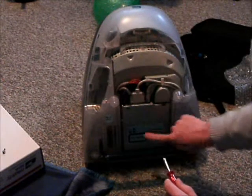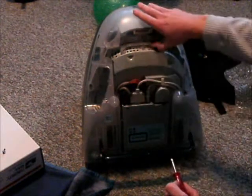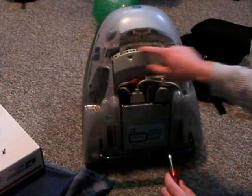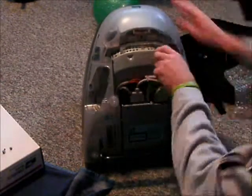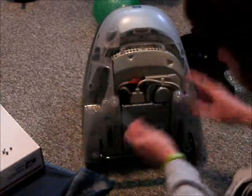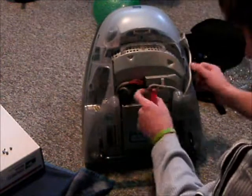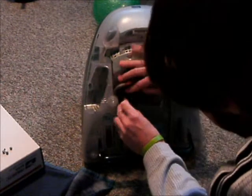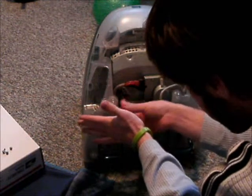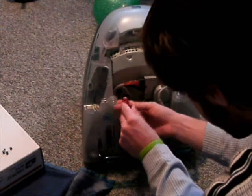Next we have our whole motherboard unit — there's the bottom of it right here. We have it all right here and there's the handle at the top, but there are two screws holding the handle in, so we have to take those out. Now that those are off it could slide out, but we have to unplug all the cables. There's also a screw down here that secures this last cable on the bottom right.